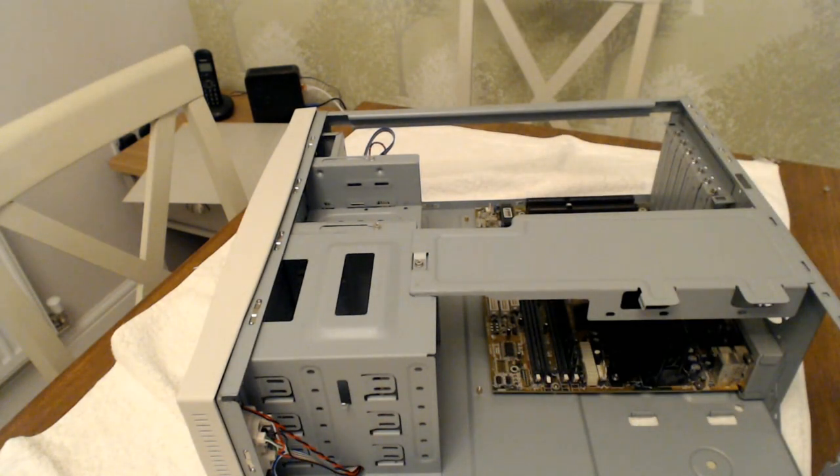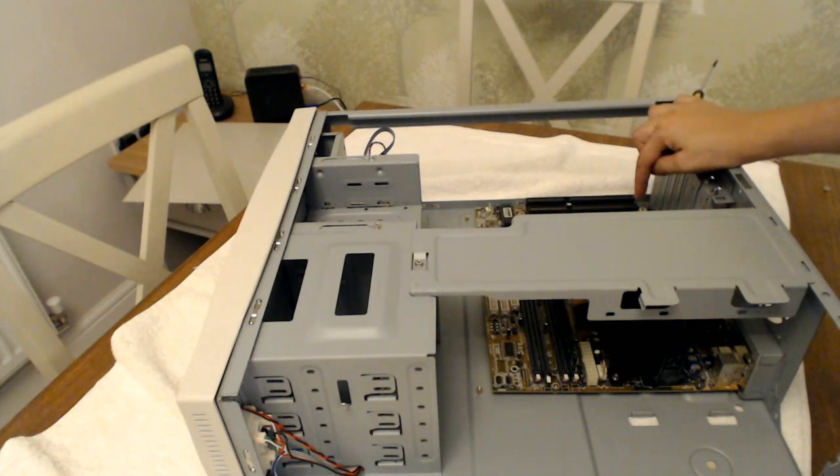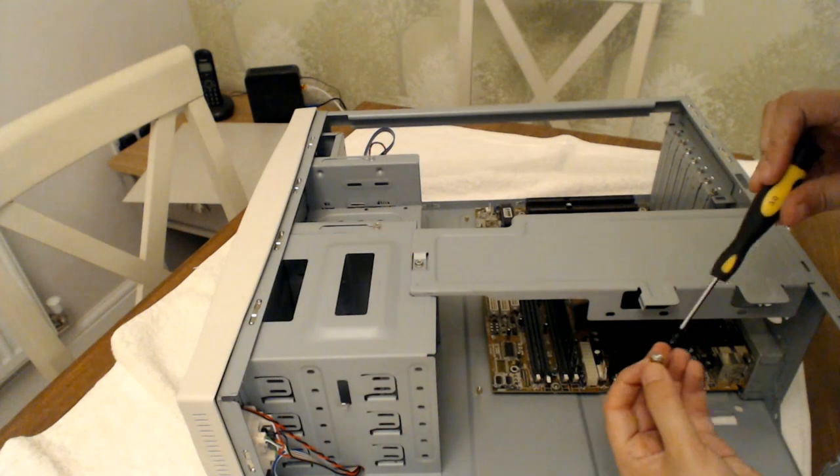Right, so I've got the motherboard in, not screwed in yet, that's what I'm going to do next. I was a bit confused because the standoffs are welded in, they're not removable, and there's two which don't protrude through the board, even though they say ATX. But where they touch the back of the board, there are no traces, there's actually a blank part of the board. So I think the board's blank there for a reason. It doesn't touch any screws that would be there, so I think it is fine.